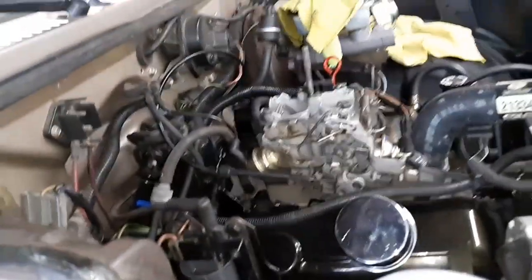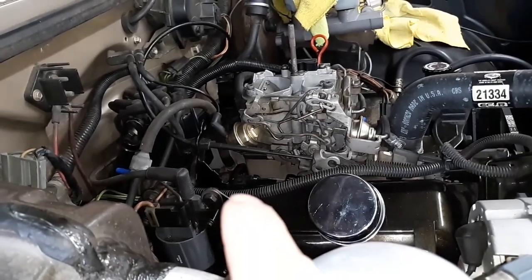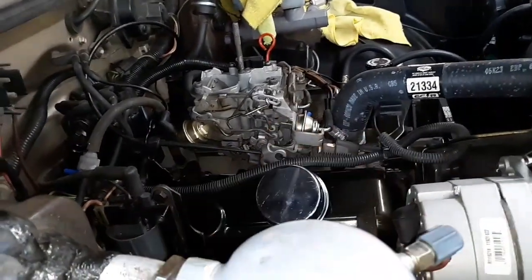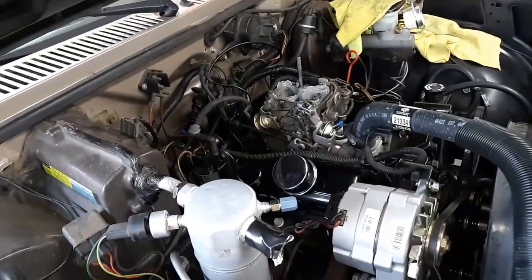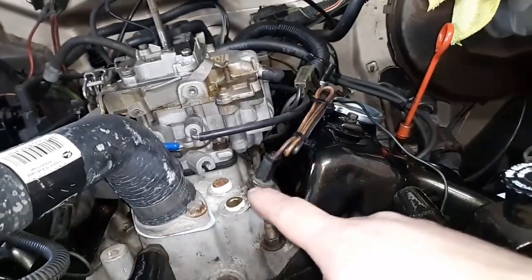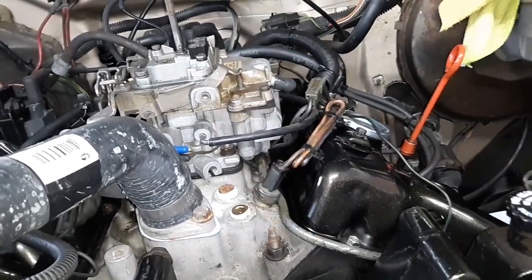And my theory is, what's going on here is the guy that had this done, or he done it himself, when they capped that off, vacuum built up so bad that it blew out the intake manifold gaskets, because these are very common for failure. When they do fail, you'll have the oil and coolant mixture, which is what this one's doing. Now, like I said, I refixed all that, but it's going to have to come apart and be fixed. I found some bolts that were loose to the intake. Another thing I found, this thing runs way too rich, way too rich. Somebody adjusted this wrong. I don't know what they've done, but it needs to be kind of just retuned itself.